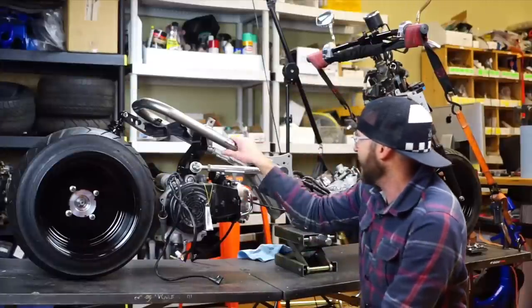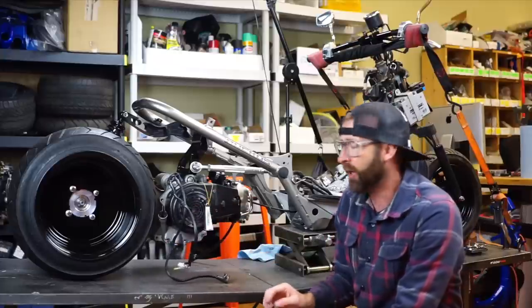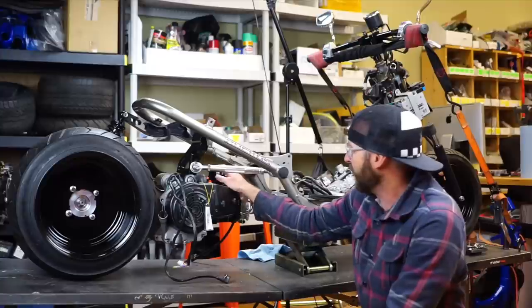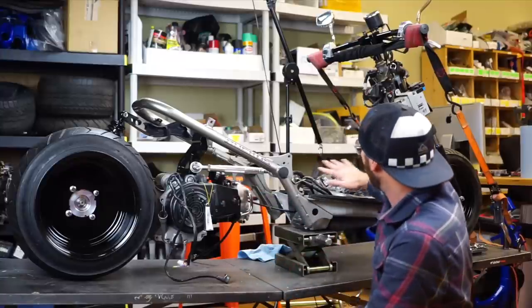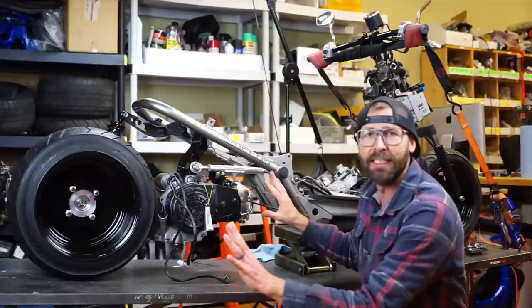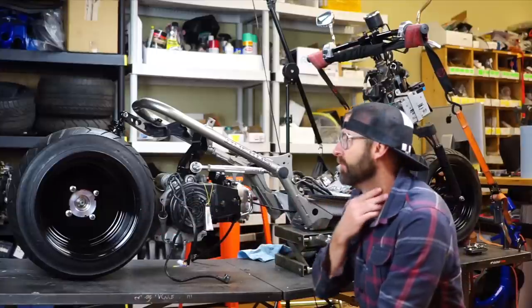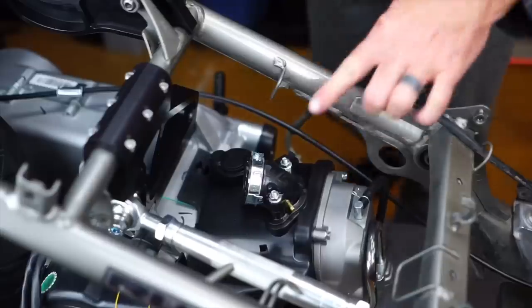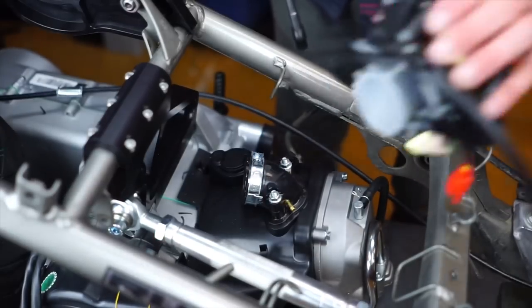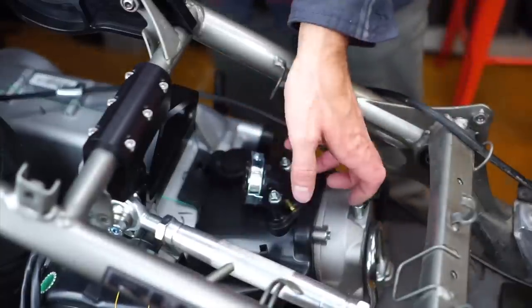The bike has a nice stance. I'm going to leave these wires — they'll come off when we do the wiring harness. I still need to do the exhaust and the carburetor intake. I'm going to leave all this open for the wiring harness, but our chassis is pretty much done. It's got done cranking down the lug nuts because I was able to hold the brake. So our intake manifold is backwards — we won't be able to fit this carburetor in there, it's pretty big. So this intake needs to be flipped around.